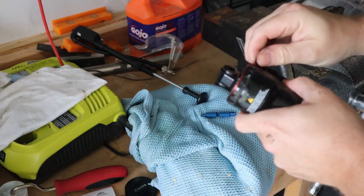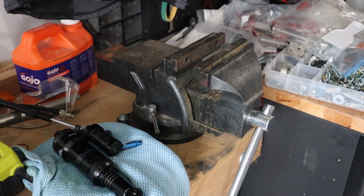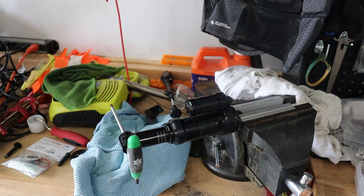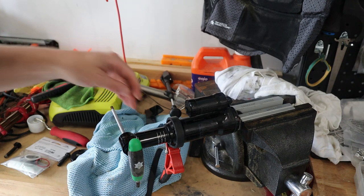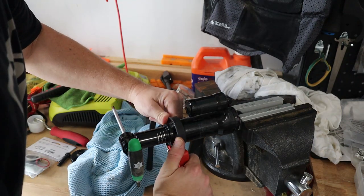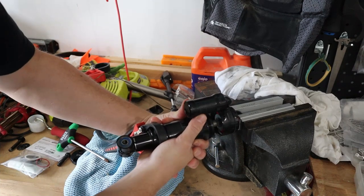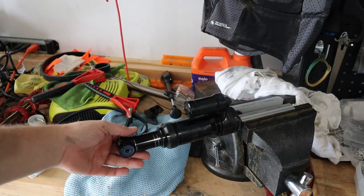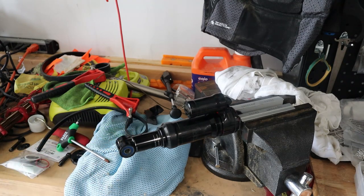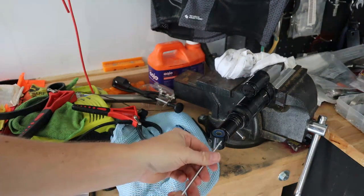The next step is to clamp the shock into the vise. With it clamped, I got the strap wrench and tried a couple of different sizes on the canister — starting with the small one. It turned right away to loosen the canister, then you pull it off — there's some vacuum pressure along the shaft — and voila. To remove the air canister completely from the shock we need to remove the eyelet, which is held by two number-three hex bolts. Oh — did I break that off in there?